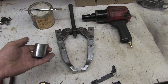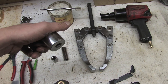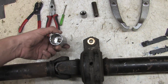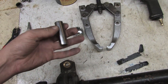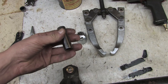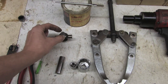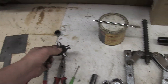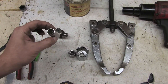On the bottom side we use a 1 and 3/16 inch socket — it's just a big one that happened to fit the size of the flange, giving it enough footprint and room for the cap to press out. We also have a 9/16 inch socket. The reason we use this is you don't want to press directly up against the tip because you could mushroom it. When you mushroom it, the cap will never go back on and work right — you'll basically ruin the joint. So to avoid that, you use this piece to press those out.